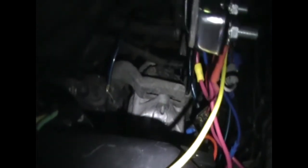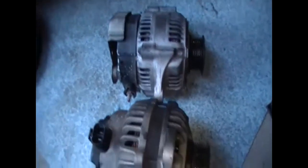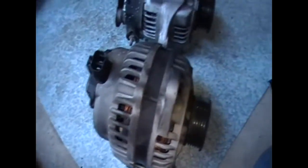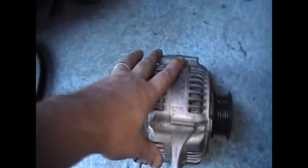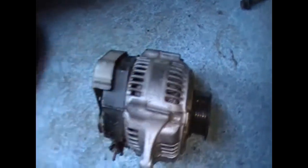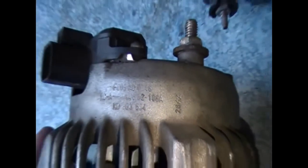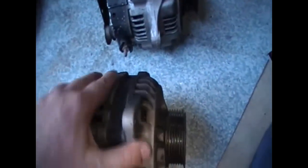I'm looking at upgrading to a Bosch alternator. You can see the difference in sizes and what I'm facing here is mounting them. I'm told the original Tarago Previa alternator does about 70 amps. This Bosch one has it written on it — the other one doesn't — it has 108 amps. So definitely a better alternator. I've already put the fan belt up to it.